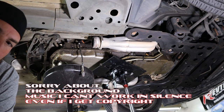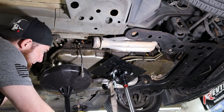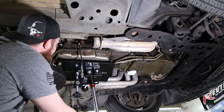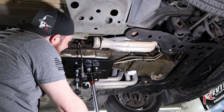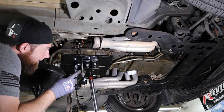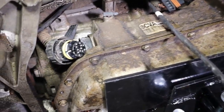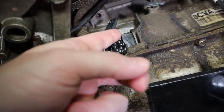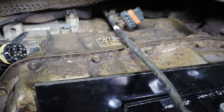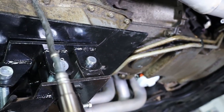So letting the transmission drain — you can kind of see it right here. As soon as I get that done, I'm going to get everything torn down to where I can work without the tranny jack being in the way. We got that plug undone — you can see this little lever. Kind of see how it connects on the back up there to the trans, it just goes in there. Then we just got to get that harness bolt off and pop that plug, pull the harness down, get the lines off, and get everything else going here.